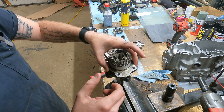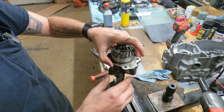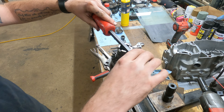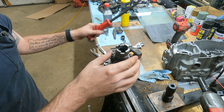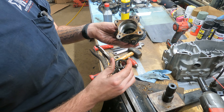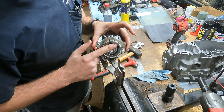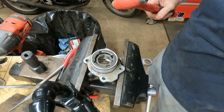My biggest breakthrough was I was trying to lefty-loosen it and it got a little tighter, so I went the other way. I used this shift piece and stuck it in there, then I took my breaker bar and laid it on top of that and was really prying on it — that's how I got it broke loose without proper Yamaha tools. Once I got it broke free it just spun right off, and then this gear also popped right out. We had to do all of that to get this nut off so we can get this bearing out.